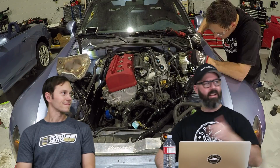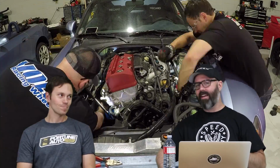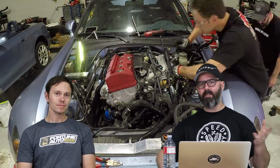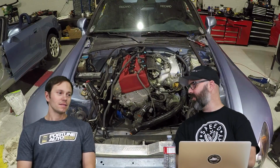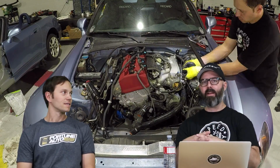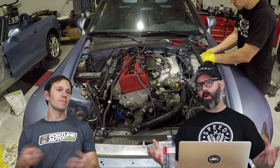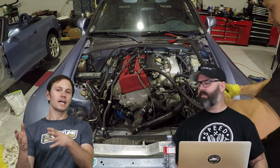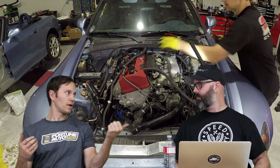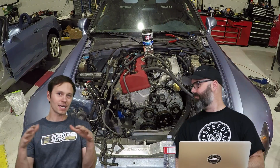By the way, I should say, Connie's got ITBs. You can buy an E46 M3 with ITBs, and those will run reliably on the street. So I think it really comes down to what ITBs you're working with, what motor it's going on, and what your tuning solutions are. It's a complex issue, and for us on the S2000 it just wasn't the right setup anymore. The Gen V stuff is literally built to go racing. It's race stuff. It's not OEM engineered parts, like on an E46 M3, where all the little hiccups have been worked out.